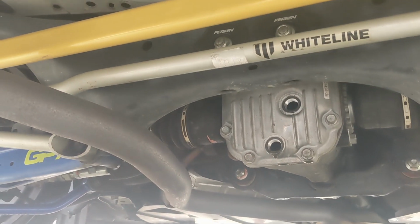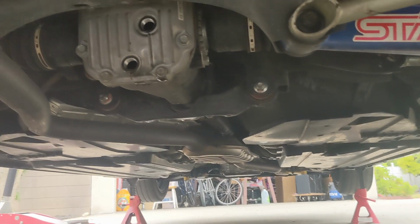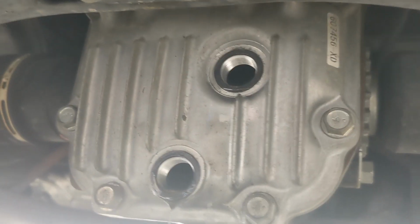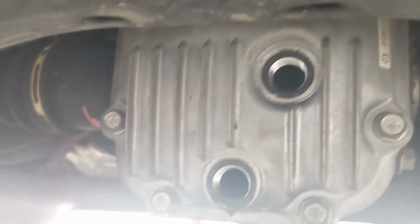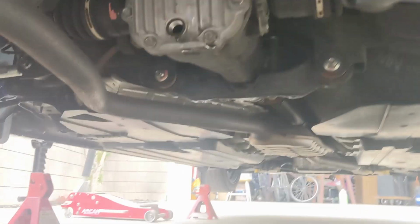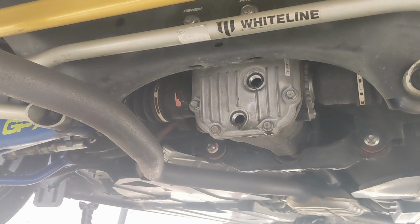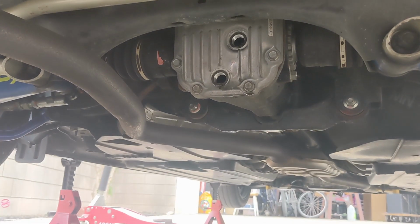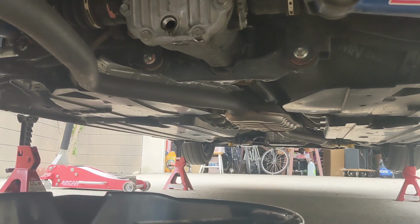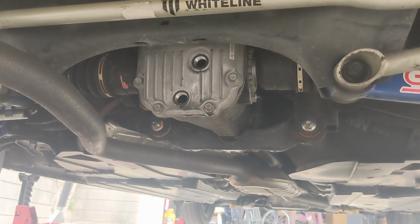So that's an interesting thing. I originally thought that these were like one-ways or something because it wasn't turning the other wheel, but somebody told me that if you hold on to the center drive shaft and then turn these wheels, this differential gear in here is going to do what you're expecting. So the CVT has a clutch pack at the front. Very interesting design. They say 60-40 front to rear power split on typical driving, and when you're really giving it the beans it's a 50-50 split, just like the mechanical differential. So those are some different driving dynamics that one might encounter between a manual transmission and a CVT.